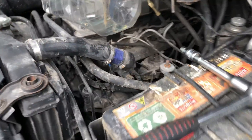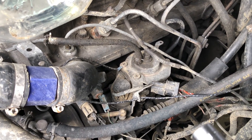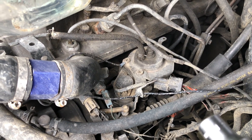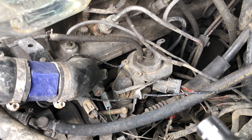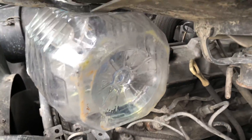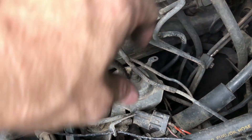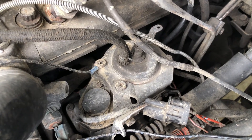I'm going to give it a little bit more. I've already got the diaphragm turned up — I didn't want to turn it the full 180 degrees like a lot of other people do without testing it first. Now that it's tested, I think I do need 180. The diaphragm is underneath here, so you undo these four bolts first, then the four bolts for the intercooler, lift it up, put something underneath to hold it, and the diaphragm is underneath. You just turn it clockwise.